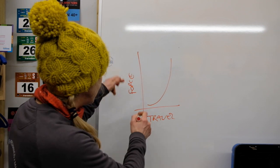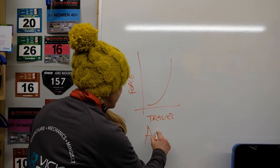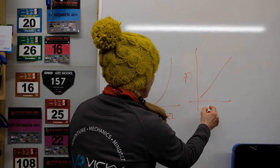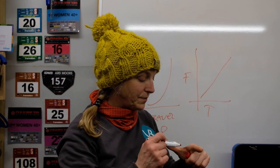In this next clip we've got Tom riding a Santa Cruz Mega Tower, and the insides of his fork have been replaced with the Luftkappe maker Vorsprung's coil spring. A coil spring is actually quite interesting. So this is the travel on the air spring. If you have a coil spring, we describe it as linear. So basically force and travel have exactly the same reaction at all points.